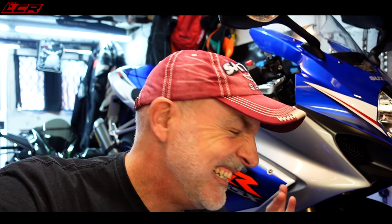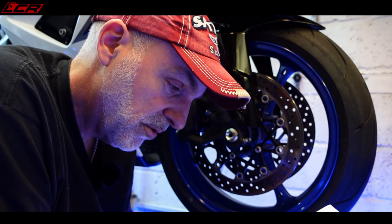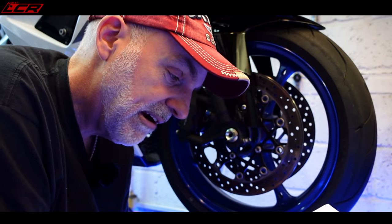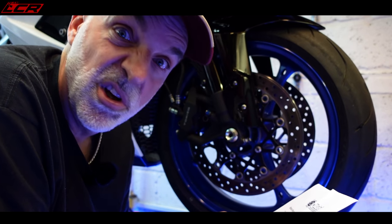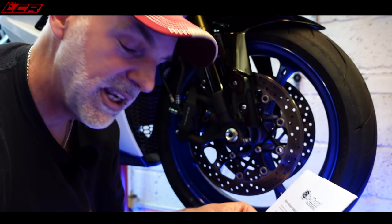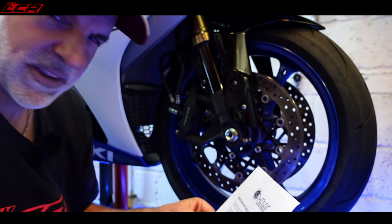As you can see, there's lots and lots to do — it's obviously not going to be all in this video, it'd be about three hours long. So first of all we're going to tackle the braking system, and then depending on the time, we'll see if we can move on to fit something else. I really want to sort the brakes out on this bike because they're bordering on dangerous. Repeatedly hard braking during a bedding period can cause an uneven build-up of friction material on the brake disc contact area, which may result in gripping, disc vibrations, or permanent loss of performance. We don't want that — progressively applied braking power is how you bed your brake discs.